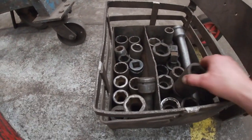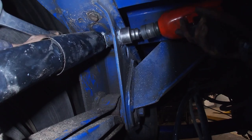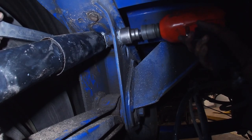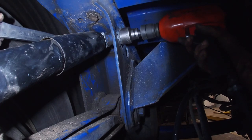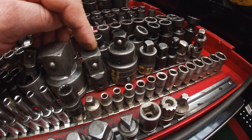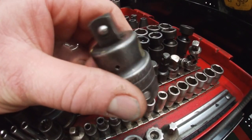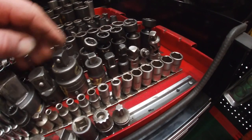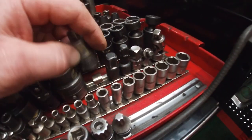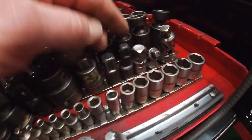So adapters - inch to three-quarters - you have the inch socket and I use a three-quarter gun with those. Three-quarter is the mainstay for commercial vehicle fitters when using on suspension stuff, and this covers from 41 to 24 millimeters. You'd use three-quarter and anything smaller would be half inch, but you can use half inch with an adapter on a three-quarter bar - something like this one here. The difference is a professional Snap-on one has a breakable sacrificial end on it that is replaceable. Same with this half-inch to three-quarter, which you'd use with very powerful air guns - generally not something you'd be doing at home.